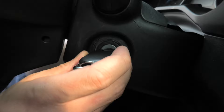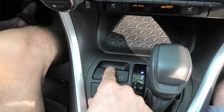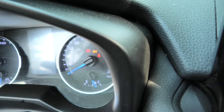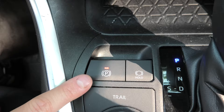So now I will turn on the vehicle into ON position and now let's do it. Pull one, two, three. Push one, two, three. Then press and hold — one, two, three, four. The LED on the button itself lights up, which means that we have successfully enabled the service mode.